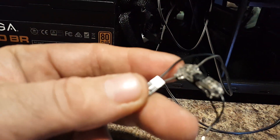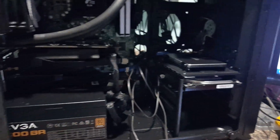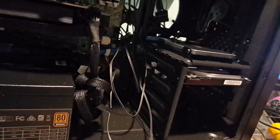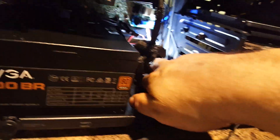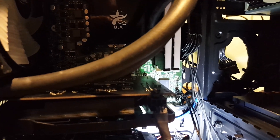What you're going to take is the first pin right after the hard drive LEDs, skip one, go down one, and these two right here you're going to jumper. Make sure you put this in the right way — that's really important. You're going to count down five pins: one, two, three, four, five — and that's where this plugs into. I won't try doing that one-handed on camera, but that's the gist of it and that's how I got everything working.